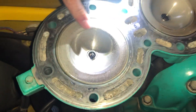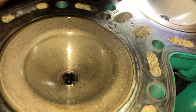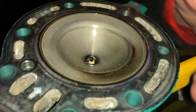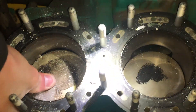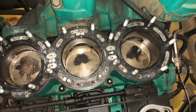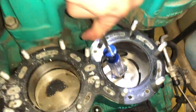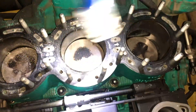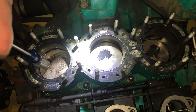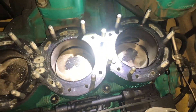We took it apart. Here's the top of the head — you can see all the different little particles of metal here, and then over here there are not really any particles. But if we come down here and push one of the pistons down, you can see it's working. But the third one is not moving, which means the bottom of the piston's not connected to the crankshaft, or the crankshaft actually broke in half. So we'll have to figure that out. But we do have motion, which is really good.